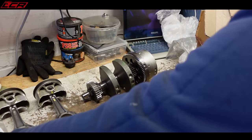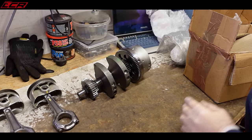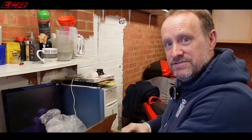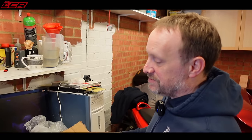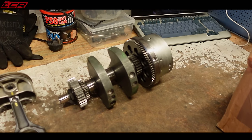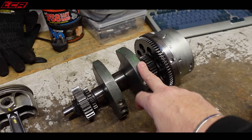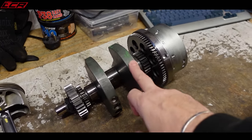The crank's been balanced — that's been to Andrew's Engineering. He does a special sort of Ducati balance, a dynamic balancer, and he specializes in Ducati's as one of his areas. He's an old fella, he knows his stuff. What he was saying about the Ducati cranks is that they use a really good metal — nothing wrong with the metal — but they do a poor job of actually balancing them. The early two-valve engines, the early Desmoquattros and even some early Testastretta's, there were massive benefits to be found by dynamically balancing them. The later engines like the Panigales are apparently much better.